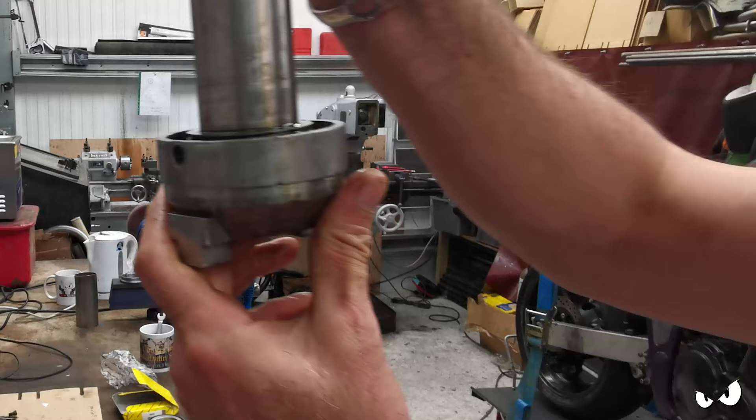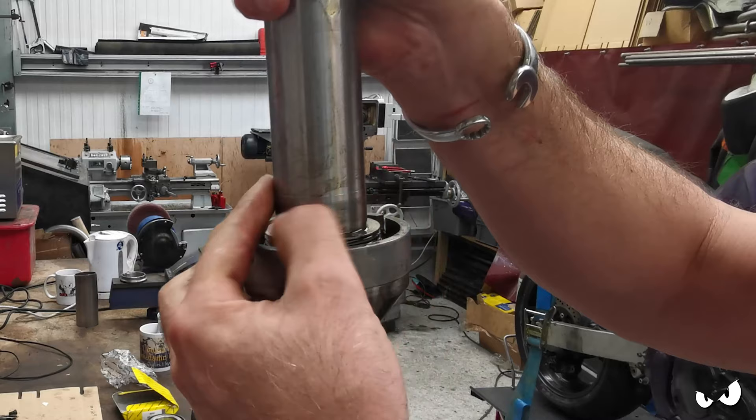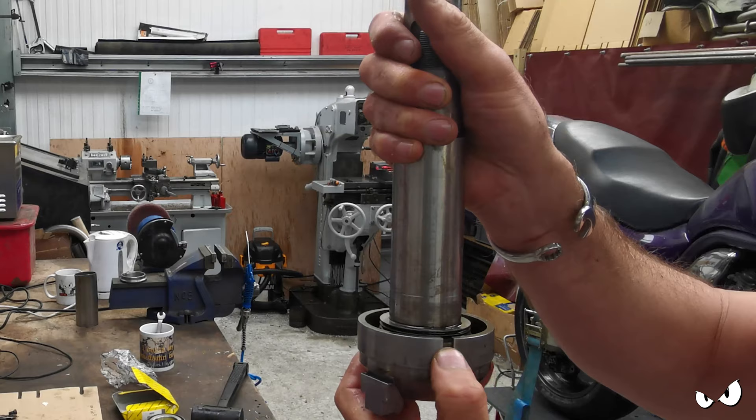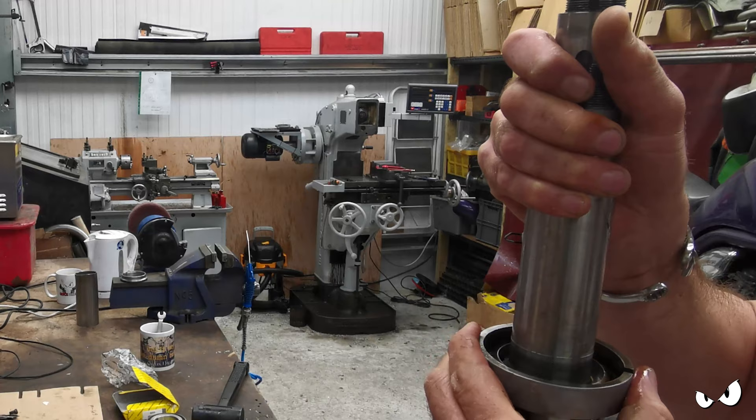Let's have a look at this. Hopefully you can see - there is a machined surface here, you can see there's a line that goes around, so this is an interference fit and the bearing's going to sit down on this bit. There is a hard shoulder that it goes up to. And this is the collar with the oil drain that I was talking about - the return - that all just pops off, however it needs to stay on there.